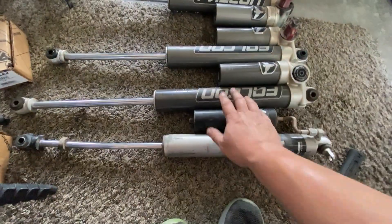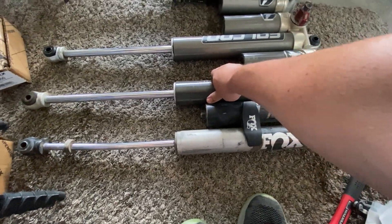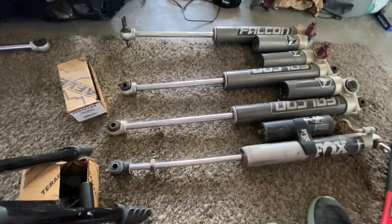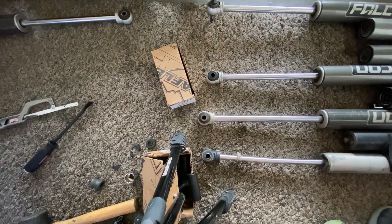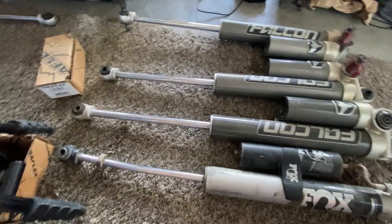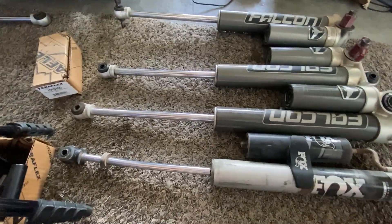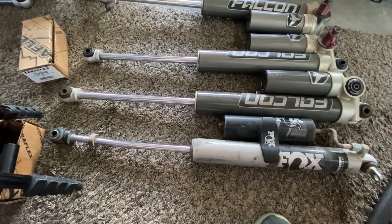So one of the things you've got to do when flipping it is change over because now that's at the bottom — you can't use that on the bottom. It's going to be a bolt-through and this big stub up top, usually a three-inch bolt. So I ended up picking up these that were for a six-inch lift from one of the guys out here. The funny part is the difference between the six-inch versus the three-and-a-half is basically an inch to inch-and-a-half in length — not three inches — and they were already bolt-throughs.